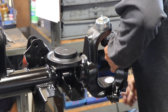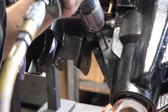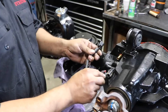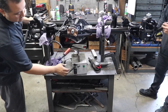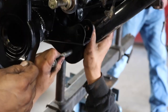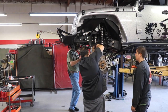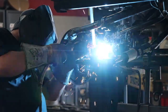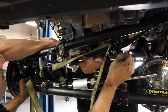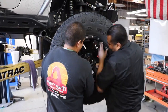Having a spare U-joint is a good part to carry with you, but I'm glad we were able to fix it here in the shop rather than out on the trail. After getting that replaced, the guys installed the knuckles and sealed up the differential housing. Steve drilled two small holes in the rib of the housing to allow the electrical sensor to be mounted back on, similar to stock. Then they tested the lockers using simulated axle shafts and an electrical box — first making sure everything spun properly, then turning the lockers on and giving it some good torque. Perfect. Installing the axle is just bolting everything back in reverse: control arms, axle shafts, bearing hubs, brake calipers, drive shafts, and steering components. They also welded up a custom steering stabilizer mount since my setup isn't stock.